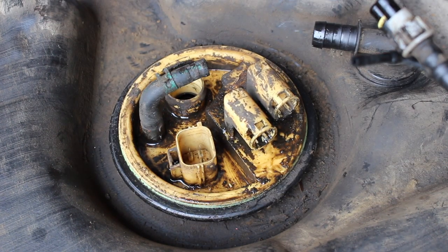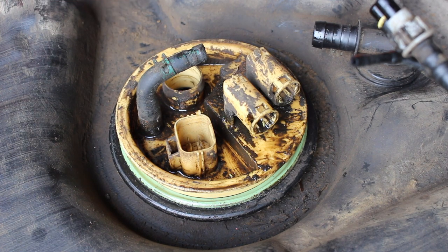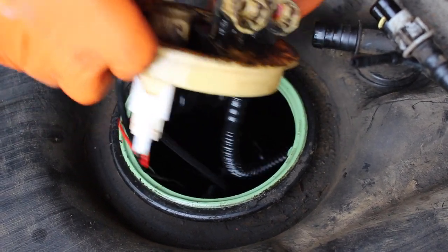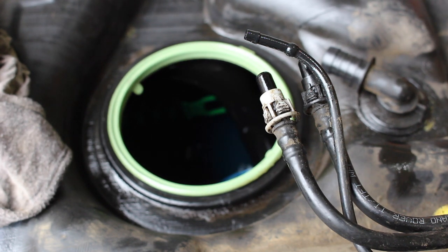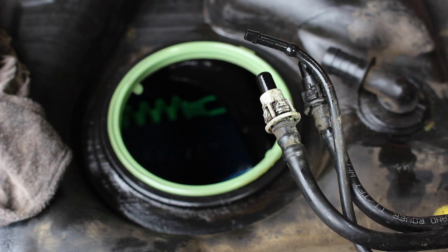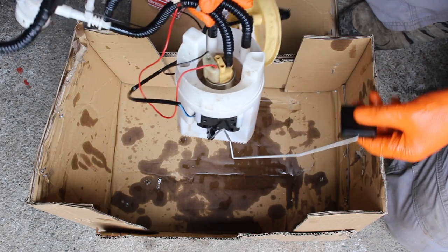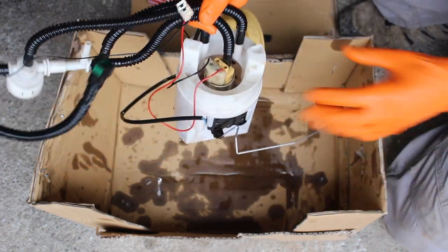The unit now just lifts out. I have to be careful to try and make this as clean as possible — I spent a while with a wire brush and the air compressor cleaning off things. We got the pump module out eventually. There's a green retaining band — if we unclip that on one side it loosens the whole module and we can wiggle everything out of the hole. This is the module now out. It comes with the level sensor for the fuel tank level, the pickup system, the return that comes into it, and the pump in the middle.